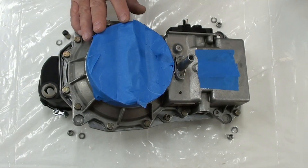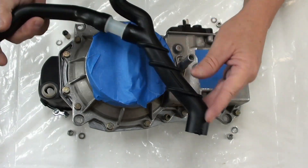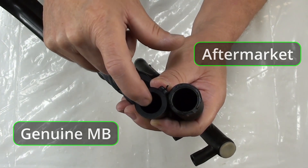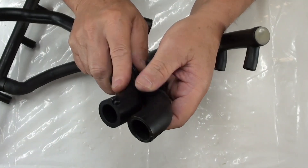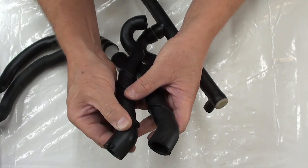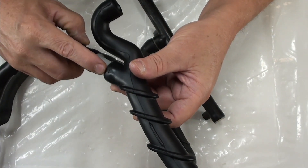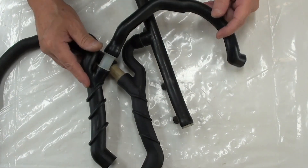Before I place this on top of the intake manifold, there are things that go under this. Let me show you the difference between this genuine Mercedes and an aftermarket — they look similar, but there's quite a bit of difference. Can you tell the hole size? This is much larger than this one. This has a little tab right there; this one does not. That tab is an important part because it also helps keep this on. The construction is different — this is more rigid, just feels stronger. Mercedes even puts little arrows on here so you can line them up when you go to place it. So, just this seal and a vacuum line — let's go over to the engine now.